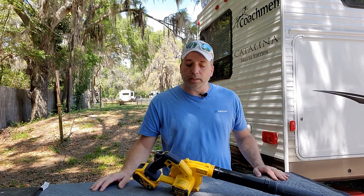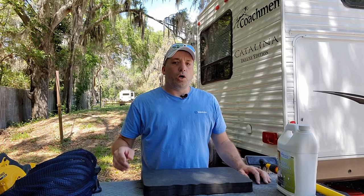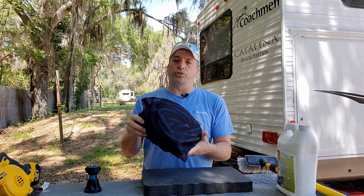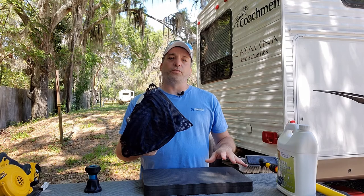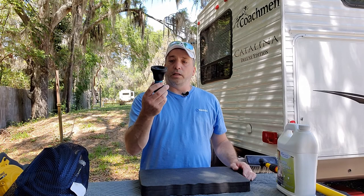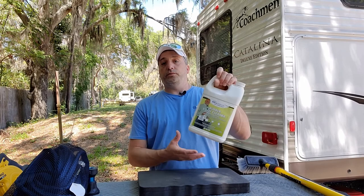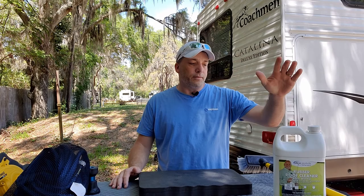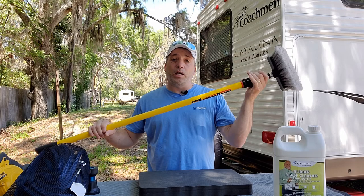Step two is cleaning the roof of your RV. You're going to need a few things for this job. First, you're going to need a hose — this is our collapsible hose, it's 50 foot, a Zero-G hose that fits in a mesh bag. We've got to rinse off the roof after we blew it off, using a little fire hose nozzle — we'll leave links down below. Second thing you're going to need is a good roof cleaner. We use the Dicor rubber roof cleaner — this works for all kinds of rubber roofs. It's a good product, works really well. Then to apply that, you're going to want a soft bristle brush on an extendable handle so you can do this job standing up.